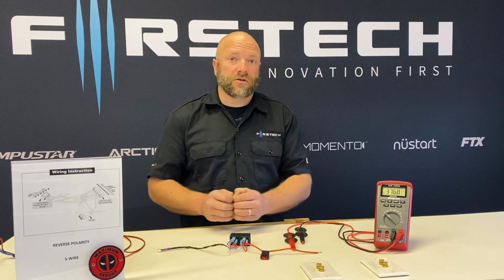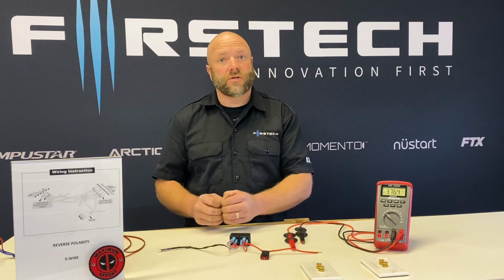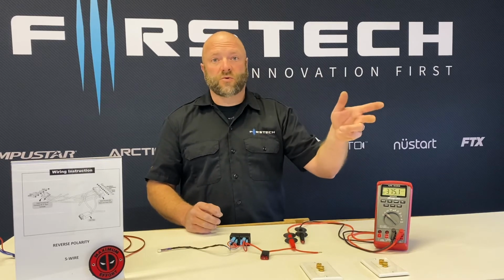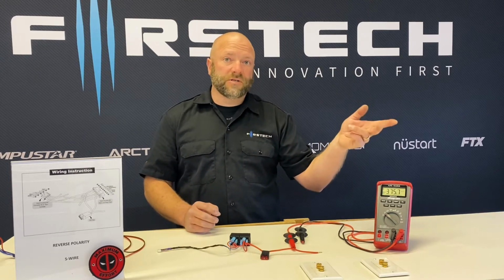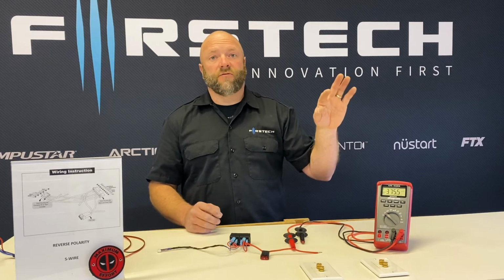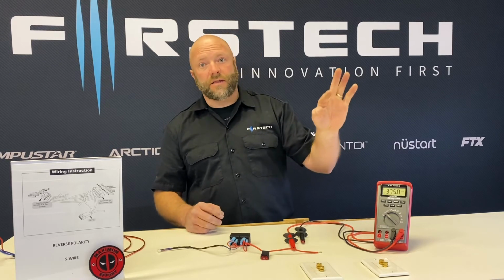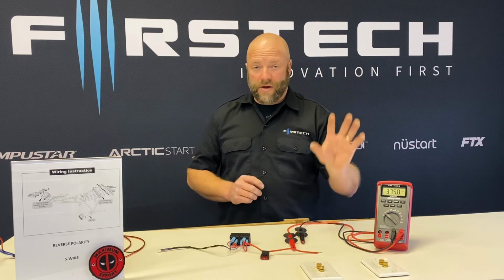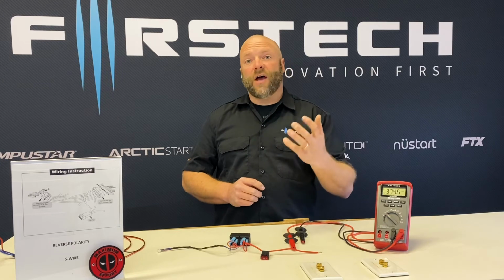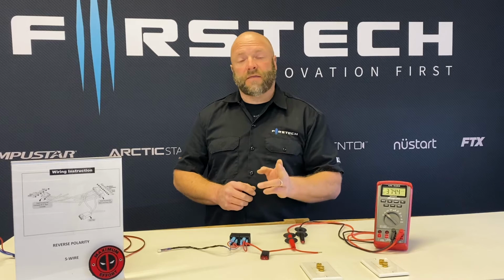And when you actuate the switch on the door, the driver's door switch or any door switch in the vehicle as far as that goes, you will see that that wire changes from ground to 12 volts while the switch is moved to the lock position for the lock motor wire and to the unlock position for the unlock motor wire. So you'll find those 2 wires in the vehicle, the lock motor and the unlock motor. They rest at ground, they go to 12 volts when you actuate the switch. Once you have verified that you do in fact have the correct wire in the vehicle, you're going to interrupt it. So you're going to cut that wire.